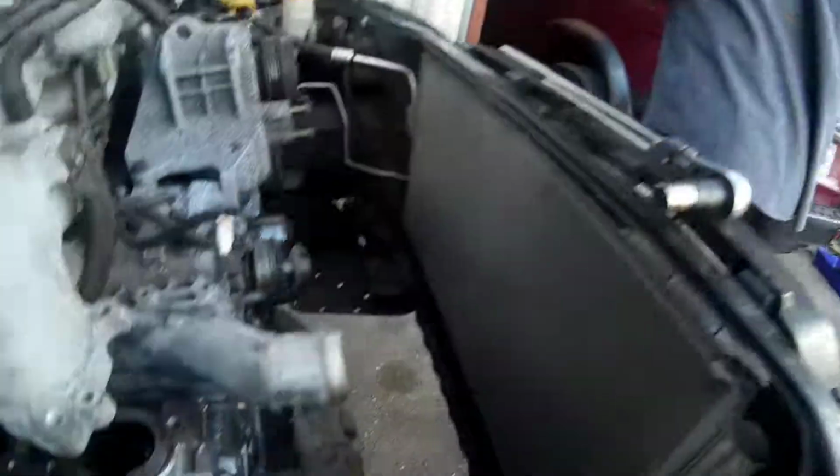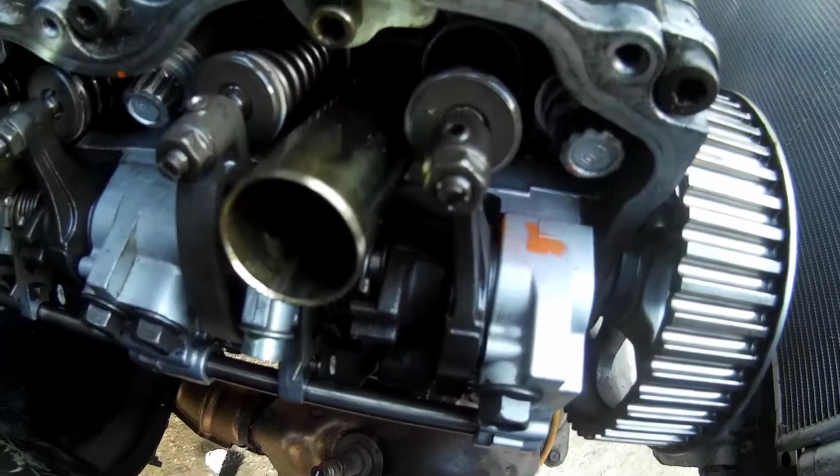Gotta do that. If you're a little bit too loose, the engine taps. A little bit too tight, as the engine warms up and heat expands, the valve's not going to seat all the way, and then you're going to start misfiring and having all kinds of other problems. So, good thing on Subarus is they allow you to adjust them. All right, adjustable valves.